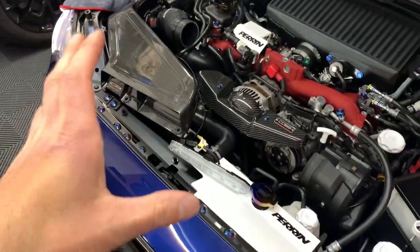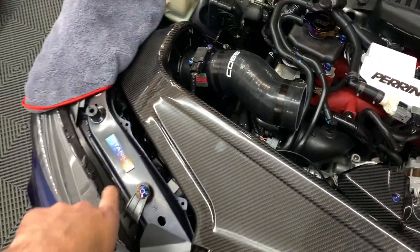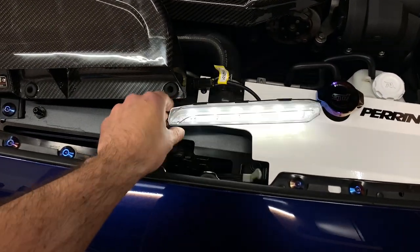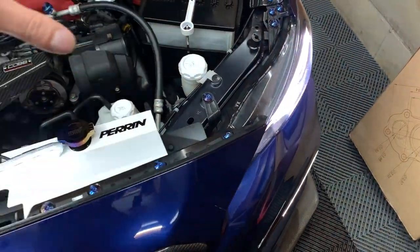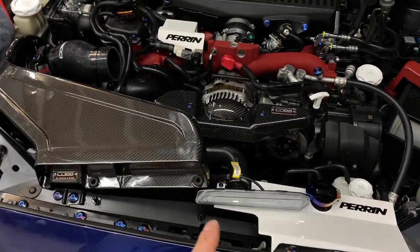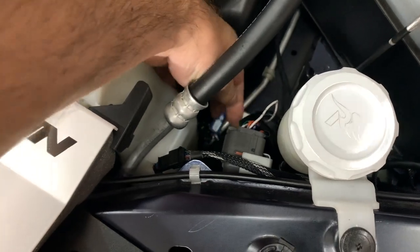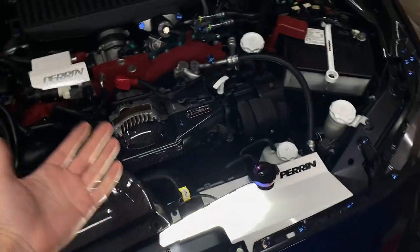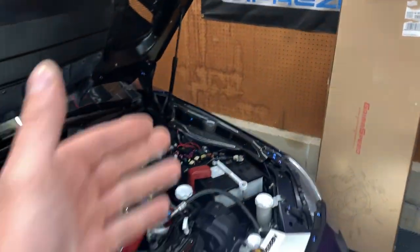So I started playing around and this is what happened. As you can see, I have my little wire tap here which just plugs right into the daytime running light little wire off of the harness, and I noticed I started getting more power. So that started getting me thinking — it's just not supplying enough power to everything over here. This side is still fine because it's connected differently. That kind of made a light bulb go off in my head — it's not getting enough power on this side. So let me try disconnecting the daytime running light little wire on this side and see what happens. As you can see, I disconnected the little daytime running light harness there, and bam, the light is working. I realized it just was not getting enough power, enough juice from the fuse box over there.